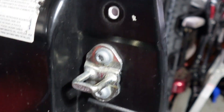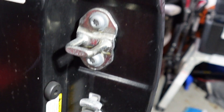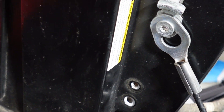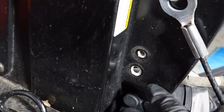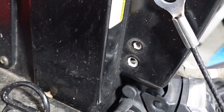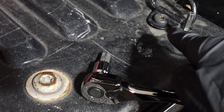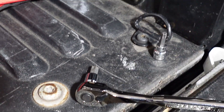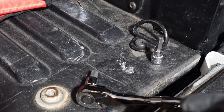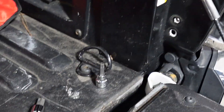Here's what the inside looks like once the taillight is removed. You don't have to remove the very top bolt — there are three total, and I think you really only need to remove one of the two lower ones, but I removed both just to be safe. We're going to remove these two bolts, take the washer out of this one, put the bed stiffener down, replace the bolts, then start marking the holes and get ready to drill.